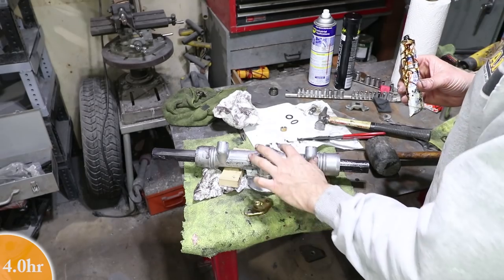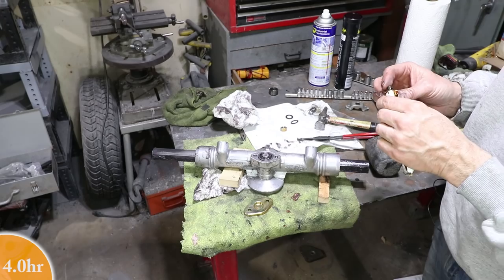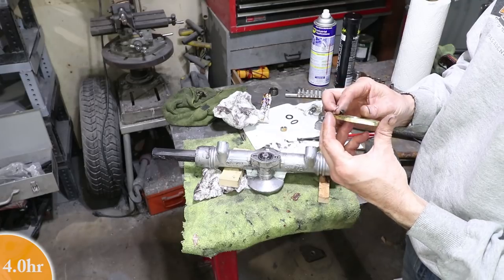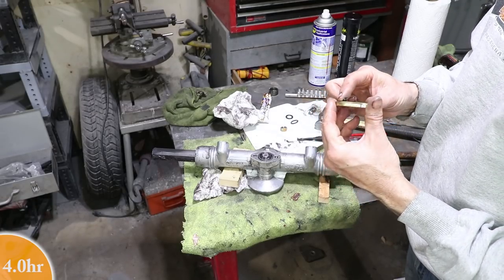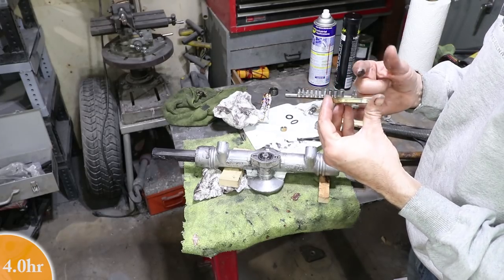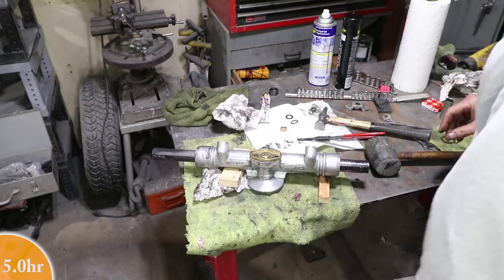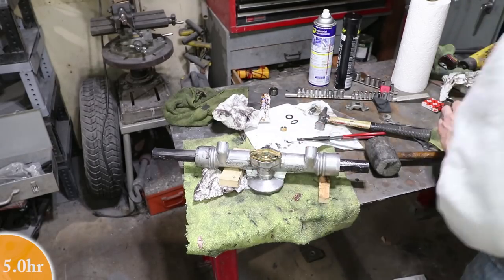There's no seal on the back side of this or gasket, but I am gonna just put a real thin layer of this Permatex Formagasket. Grease typically doesn't leak out, but over time it might separate and come out just a little bit, so I'm just gonna go real light just around the ends here. These are the parts that I also did the chromate plating on last week.